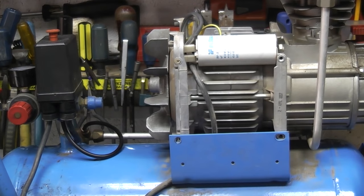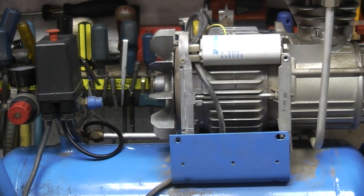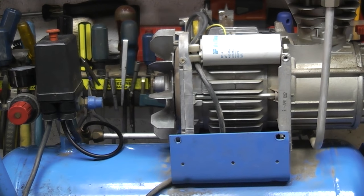Let's plug it in and see if it will run. There we go! So what had happened was switching it on somehow the motor got jammed, and the cutout switch was activated to stop the power going to the motor to prevent the motor burning out. But in the instructions for this it doesn't mention the cutout switch at all. So I wonder how many of these have been thrown on the scrap heap, people thinking it's burnt out and packed up — go and get a new one.